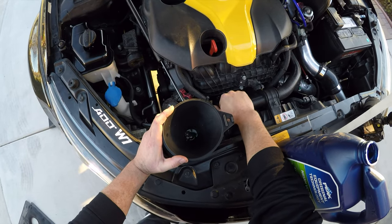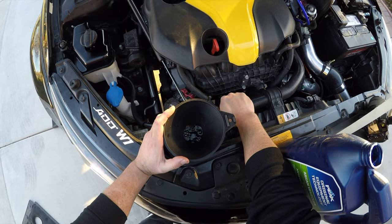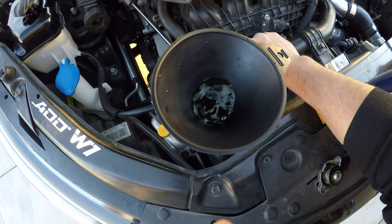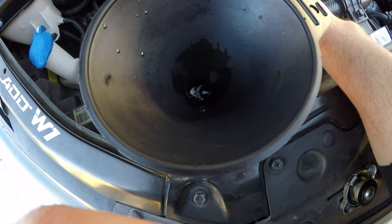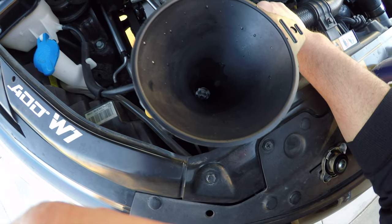But now that the motor is cycling all this coolant, we're gonna be able to make sure we have no air pockets by bleeding the system. Right now is a good time to check if there is any leaks within your radiator. Pretty much good. We just gotta continue bleeding the system, and that'll be pretty much it. It's that simple, you guys. This is how it should look at the end. No bubbles. Looks straight up just like some green Kool-Aid.